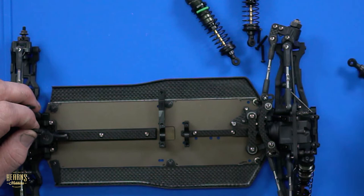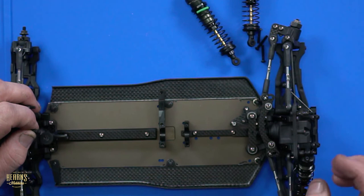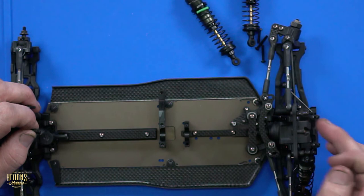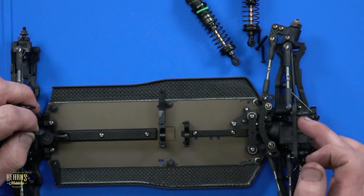Two things. When you do the nut up, you can actually do the nut right up until it bottoms out on the aluminium. And it doesn't swell and make the shock go tight, like all jammed up there. The other thing too is, because it's threaded, it adds extra threaded strength to the bolt. So if you do bin it, which happens a lot, particularly when Brett's driving, you'll bend the screw, but you don't necessarily snap it.